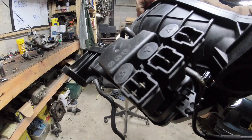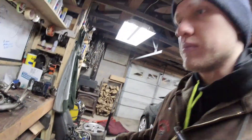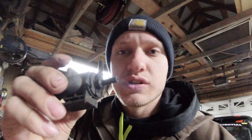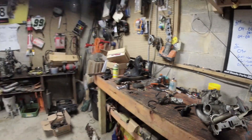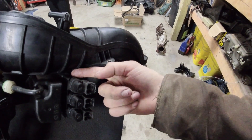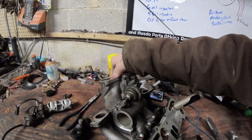There are three solenoids on the back with Mitsubishi logos and little hoses going in and out. You can blow on them with your mouth — basically the same as testing a solenoid from a supercharger or similar. You've got two prongs; blow in it, then hit it with 12 volts and it should click open and vent out the appropriate side. There are some differences in how these operate across model years, but you can check them with a power probe or alligator clips to make sure they're pushing air to the right place.